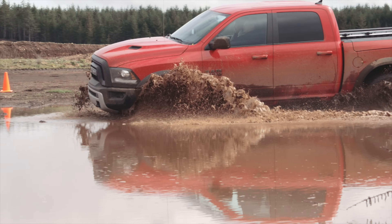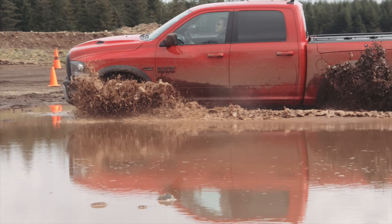So it's a good idea to use traction control when rock crawling or in snow most of the time. But if you're in sand or mud, it's a good idea to disable it to allow for some wheel slip and let the engine always provide full power based on your throttle input, rather than having that power taken away from you.